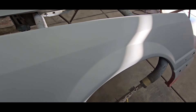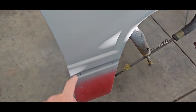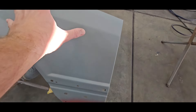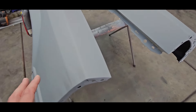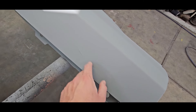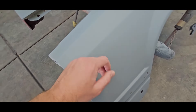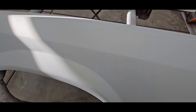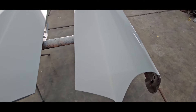Here's the fenders. The body line looks good. There are a couple little sags in this area here, same with right here - kind of like the more flat sides of the panel. That primer is really thick, and you would think there'd be a heavier sag right here, but you can see it's not a big deal. This stuff is already like dried up a touch - I mean I'm not getting anything on my hands at all. There's a little sag right here but overall not too bad. The body lines look pretty good on them. I'm pretty happy with them overall - I think they'll look pretty good with some paint on them.